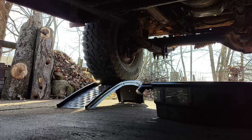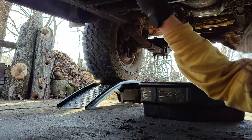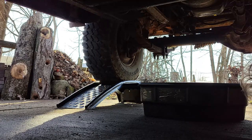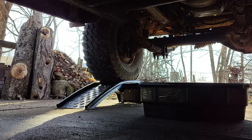I'm trying to get stuff off this crossmember so I can see if it's actually leaking above it or not. Right now I'm trying to get this transfer case cleaned off - this used to not be this bad, was fairly clean two years ago. It may actually be leaking from the main seal between the transfer case and the transmission, but it's just horrible everywhere. Hard to tell.